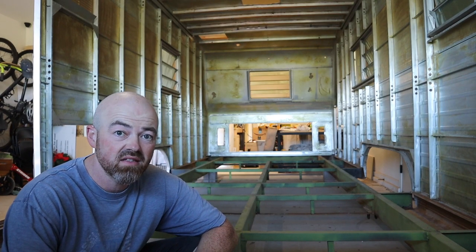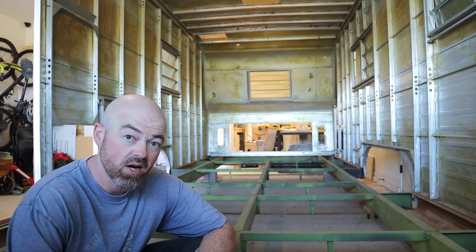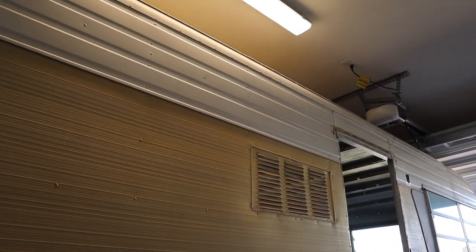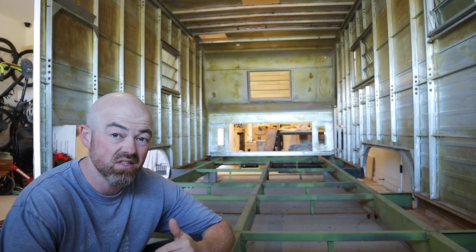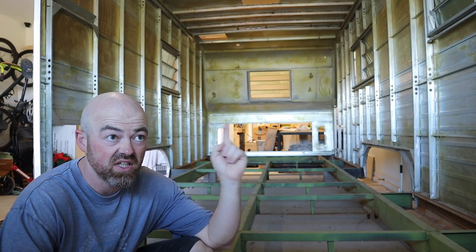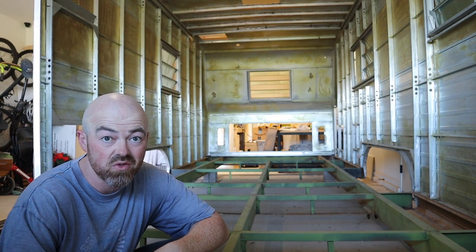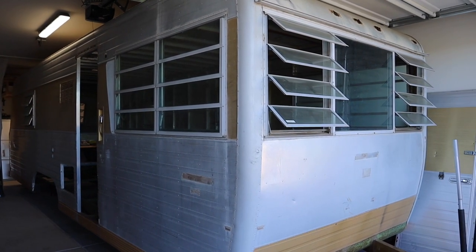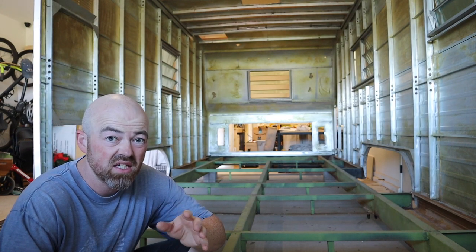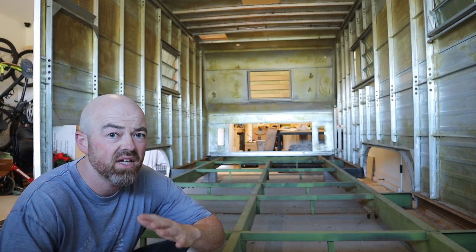As you can see, we're basically done with the teardown. I say basically because since we're in the garage due to our HOA and we can't work on it outside, I only got about 9 inches of clearance below and about 12 inches of clearance above, so you've got to choose your battles. Right now the roof has not been touched — we're going to deal with that later. But we've got the entire floor out, we've cleaned up the walls, we've cleaned up the frame, and removed everything that was bolted to this thing except for the windows, because the windows are actually the old school bullet-type rivets. We're going to leave those in, as the windows can be worked on with the frame still in the trailer.